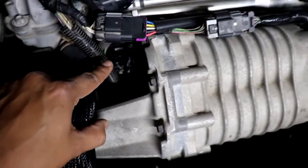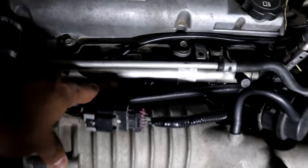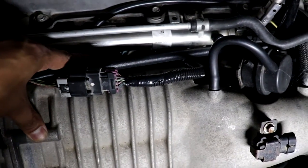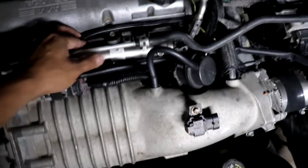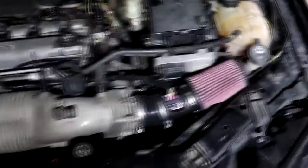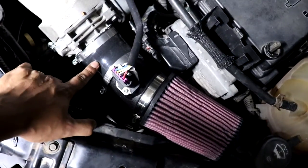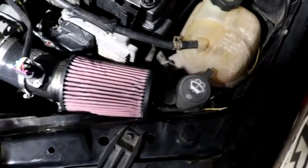For the 2.2 the MAP sensor will be there; for the 2.4 there's a wider nipple on the bottom of that section where you'll hook up a vacuum line to the sensor. Right now there's a vacuum line on the manifold routed to the boost gauge inside the car. I also had to modify the 45-degree elbow from GZP — had to cut it shorter so I could fit the filter on top.